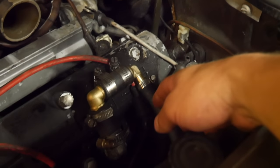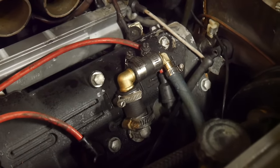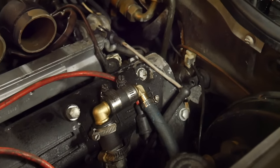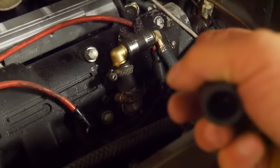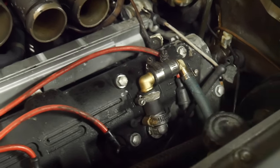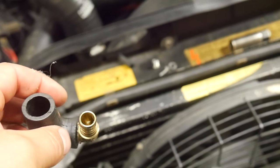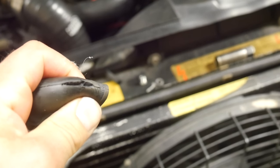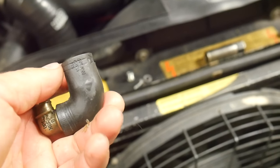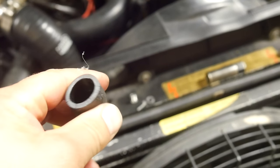I've made a little bit of progress here. This is the new oil return from the turbo — I'm still not happy with it, but I made do with what I had available. It originally went to this location and I'm not really fond of this going to the valve cover. If I'm being completely honest, I wish it went to the pan, so that might be something I change later. The old oil return I took off had this PEX fitting and this random hose off something else. Let me show you why I replaced it — this was a pending disaster. It was all dry and hard, likely not meant to have oil go through it. Had I not paid attention to that, it probably would have evacuated the oil all over the driver's side of the car. It would have been a very bad day.